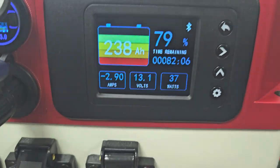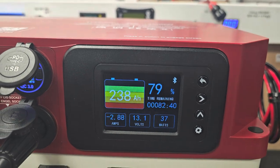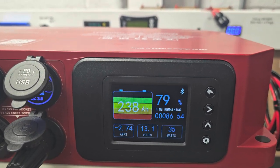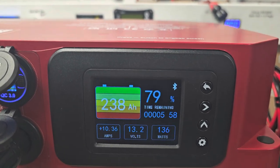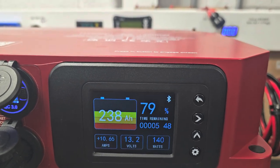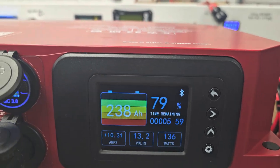Let's see what that climbs up to — give it a couple of seconds. So that's just raw 28 volts straight from the solar panel going straight into the side of the Hardee. Let's see what it kicks in at — quite a nice day. So we are charging up at around a net of 140 watts, but don't forget the fridge is using about 40.